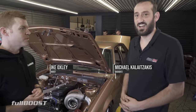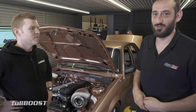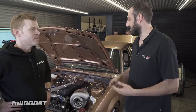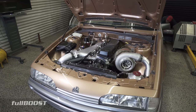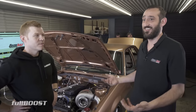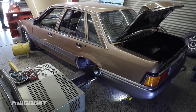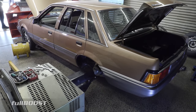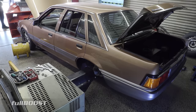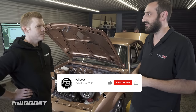We had the pleasure of tuning CK's car today. We've done a bit of a cocktail on fuels, just seeing what works and what doesn't. We've done a cool swap from E85 to E98. We actually made less power on E98, which is what you'd probably expect with a fuel that's got a higher octane in an engine that can't use it. If we optimized ignition timing and mixture, it probably would have gone a little bit beyond, but we just wanted it for the safety buffer so we can turn some more boost.